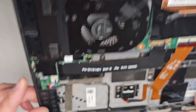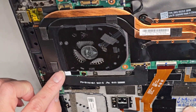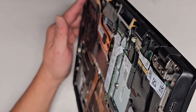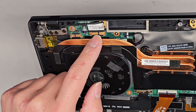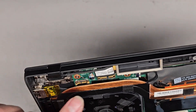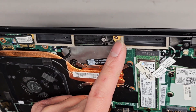There's a little connector here — I'm not sure what that's for. Headphone jack there. There's what I thought was a DC jack charge port but it's actually just a USB 3 port — looks like it's connected to the motherboard. Then there's a screen connection here, most likely for the microphones and camera. And this is the LCD LVDS connector. There are also the wireless antennas — you can see the little gold patch going underneath, and then the other antenna as well.